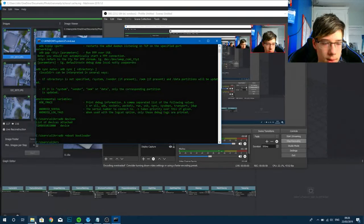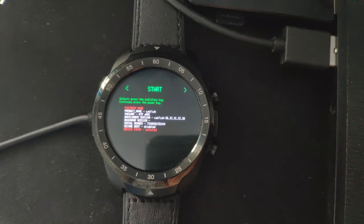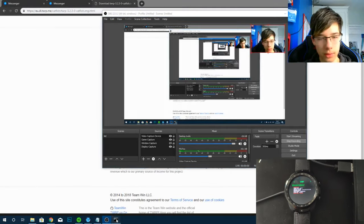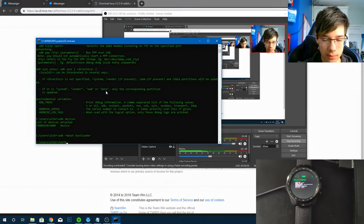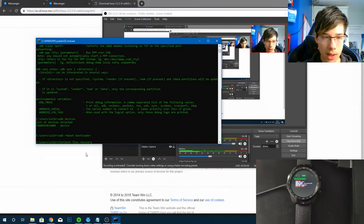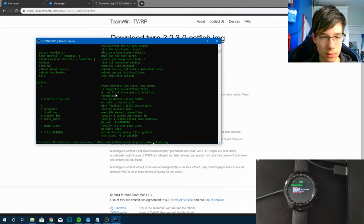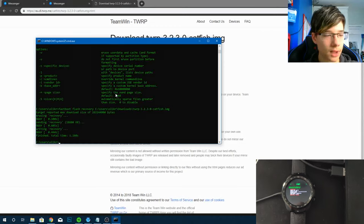There we go. And I need a camera on the watch. And this is what you're going to get. You're going to get the bootloader. From there, I'm going to have all the download links down in the description below. Once you're there, you want to type fastboot flash recovery and grab the TWRP image like this, press enter. There, press enter. That'll finish.